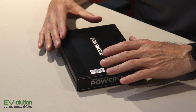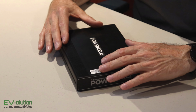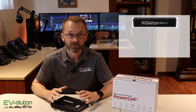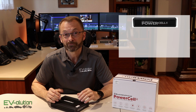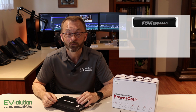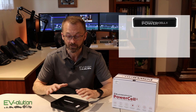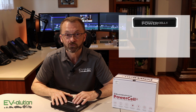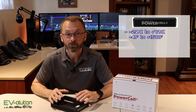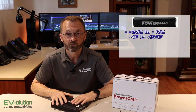So what are the advantages of a lithium iron phosphate battery pack as compared to lithium ion? Well, lithium ion in extreme heat tends to like to blow up. That's not good when you want to put a battery pack inside your car where the cabin can get quite hot. The nice thing is that this will have an operating range of -20 Celsius to +70 Celsius, making it very safe, and this has great thermal stability.